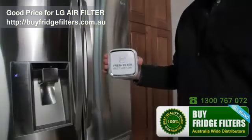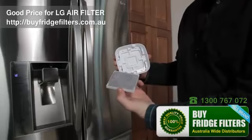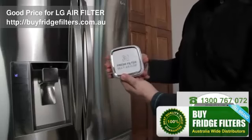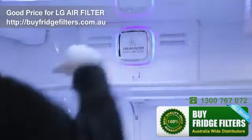The old filter is located on the inside of the filter cover. Remove the filter from the cover in order to replace it. On the new filter, the side facing outward should say Front. Place it into the filter cover. To reattach the filter cover onto your refrigerator wall, turn the filter cover to the right.